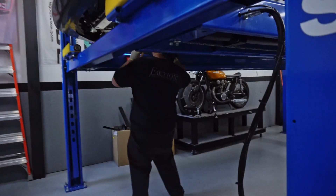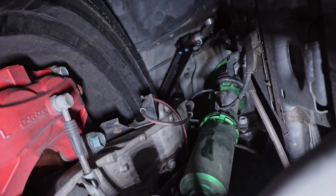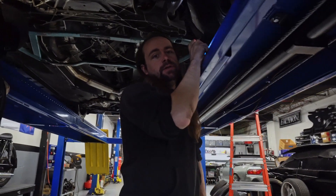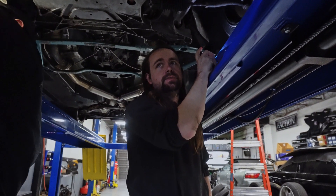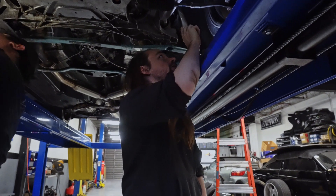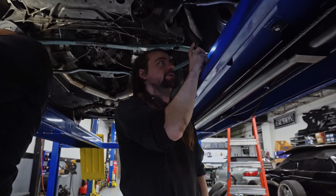And by 'we' I mean Chris, and he'll show you how to do this. You can pull for camber and caster simultaneously. The best part about these arms is that you can adjust them on the fly — we don't need to disassemble the wheel and take everything apart, adjust it, throw it back on, and pretty much hope that it's right. Because if it's not, then we've got to disassemble it again, adjust it again, put it back on. With these SPL arms, you can adjust them from the outside — very easy to work on.